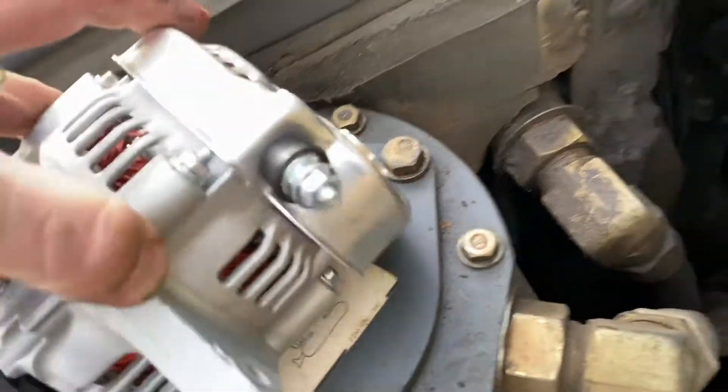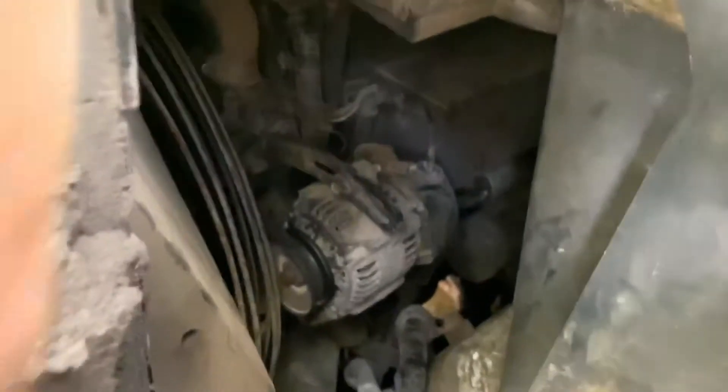On the PC50 MR2, it looks like the bolts that hold on the alternator are 12 millimeter. You're going to unbolt the top and bottom bolts, remove the electrical connections — there's a plug on the back as well as one right here. Loosen up this top nut right here, and that allows you to move the alternator back and forth to get the belt off. Just make sure you only get the belt off the alternator so it's easy to put back together.